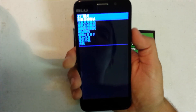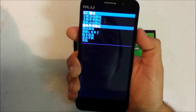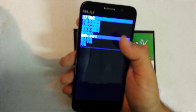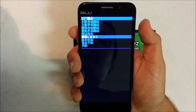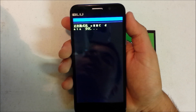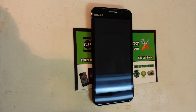Let go when the screen appears. This phone seems to be in Chinese, but what you're going to do is scroll down five times — so it's going to be the sixth option down. It should say something about eMMC. Confirm by hitting the Power button, and that is what's erasing everything on the device — it's completely wiping everything off.